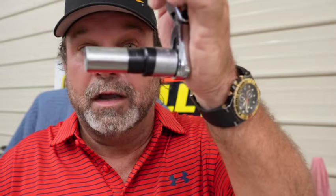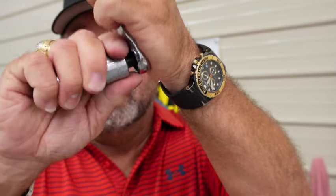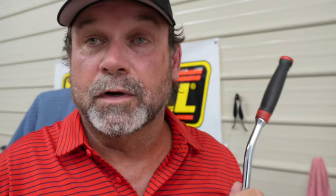They're not guaranteed to be a hundred percent, but the fact is you can do it that way and bring out the sockets one at a time. Or you can choose to do as I did — again because I had room — I was able to disengage the ratchet and pull this out in one assembly, and because it had the little rubber grommet in there, it also brought the spark plug out with it.